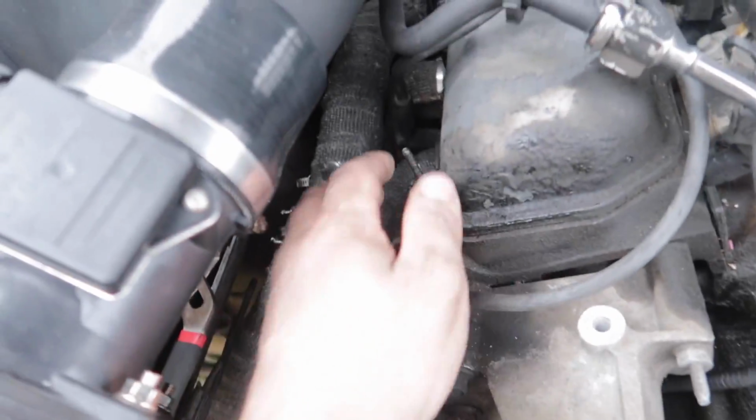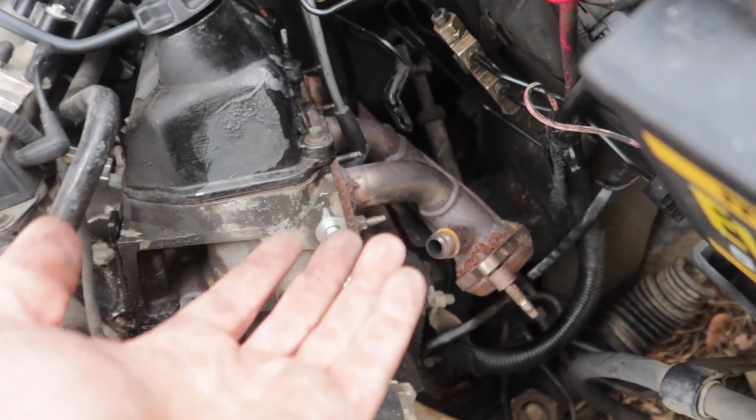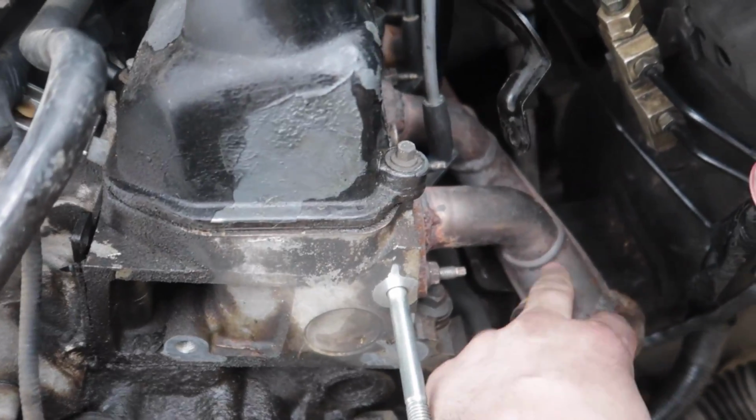The reason why they don't fit is because the bolts right here, you can barely get them in. Like, I can only get three or four header bolts in there. And if you can only get three bolts in, then it's not worth even having the headers. And on the stock ones, you could see all of the bolt holes are really easy to get to. I'm just gonna cut it right here, most likely, and then weld down from there. Bring the turbos up here.